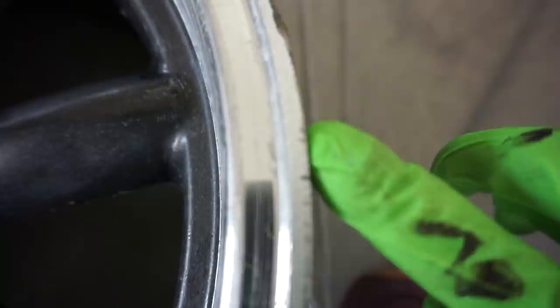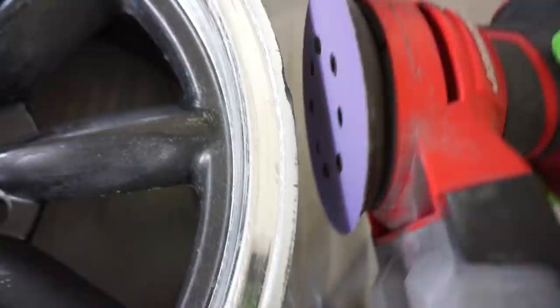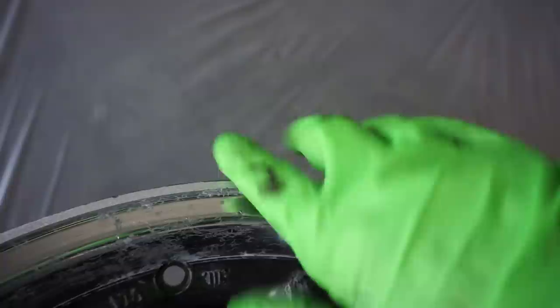Check this out — this is a major repair that needs to be done, but if you keep going just a bit more, all of that will go away. Try to keep it even and don't worry about taking the lip out — the lip is extremely, extremely thick, so you'll be able to sand down until all this disappears. What I like to do is hit the sander at a 90-degree angle so I can start making the lip as straight as possible, trimming down any dents to make sure it's perfectly even.